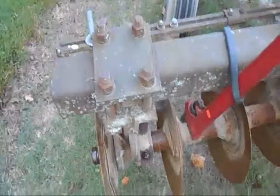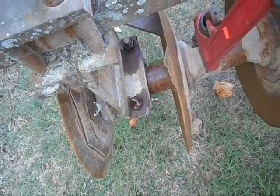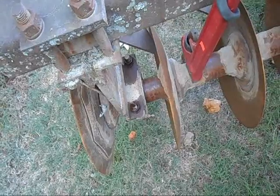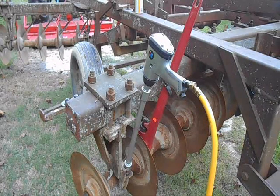Now the next bolts to break loose are these right down here. I can't tell what you can see on this camera display — I never know what I get until I get back to the computer. We'll get the impact wrench and try it out. Got to charge up the air compressor. I bought this impact wrench and I was a little disappointed that I didn't have a big enough socket to get that axle bolt, so we had to break that off manually. I sprayed these nuts and bolts about 30 minutes ago, so let's see what this thing is going to do. I've got it set on 230 foot-pounds of torque with 100 psi behind it.